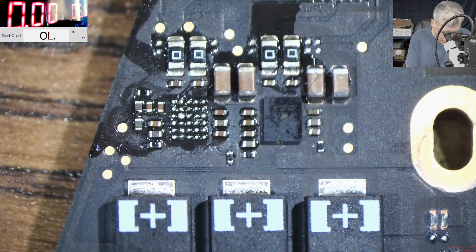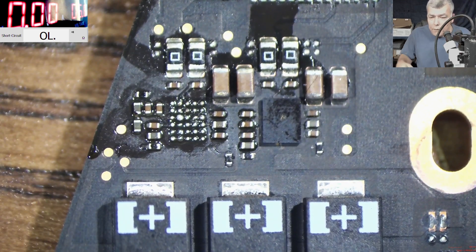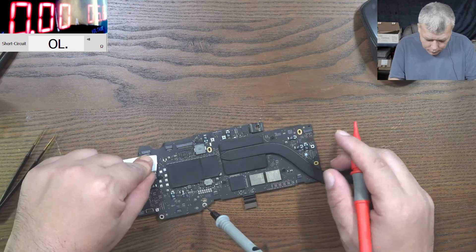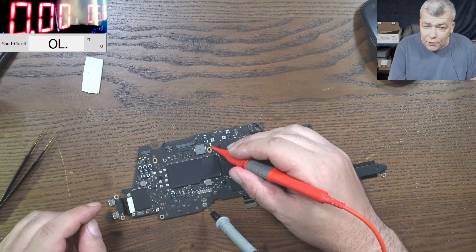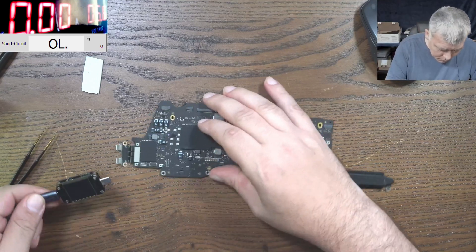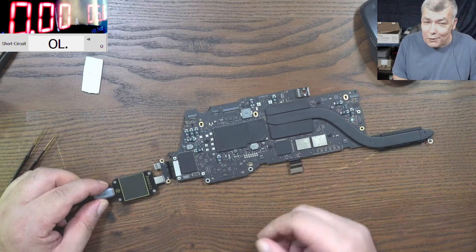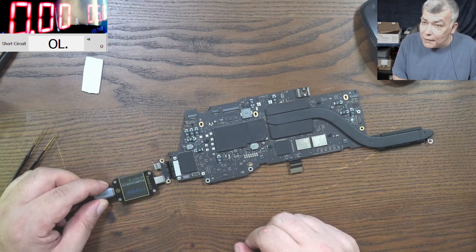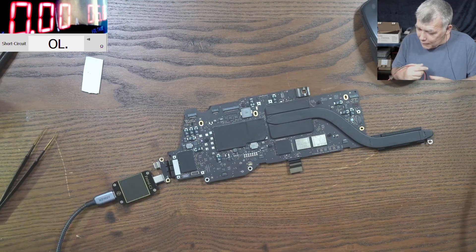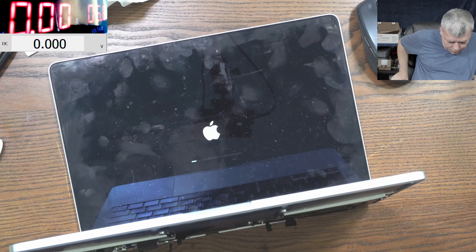Actually it was the chip — or some capacitor. Now it's fine. Let's see what's getting hot on the main power rail — that's fine. It's taking nothing now, no current at all. Let's check with the charger. It's working! We have 19 volts — the board is negotiating the voltage. The main power rail is present. The main power output is 12 volts — 200, 300, 400 milliamps.